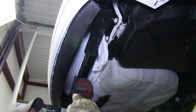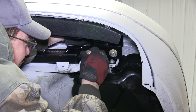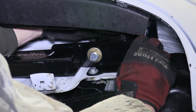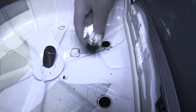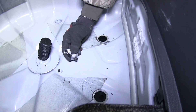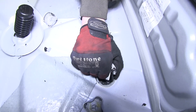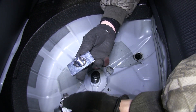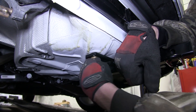We'll feed the driver side up over the exhaust and bring it tight to the bumper beams. Then we'll install our long bolt into the bolt plate. Now with all the bolt plate fasteners secured, we can go ahead and install the carriage bolt and block. Before we install the carriage bolt and block, we'll use some silicone around the trunk pan holes and around the block itself. Then we'll drop them through the attachment points and secure them with the conical tooth washer and nut.